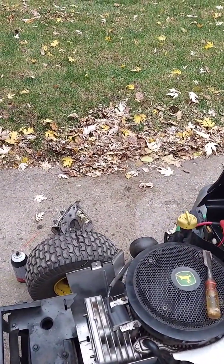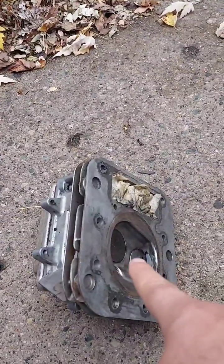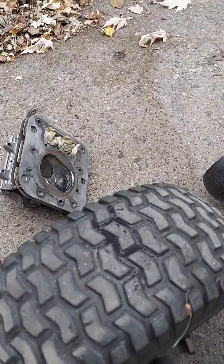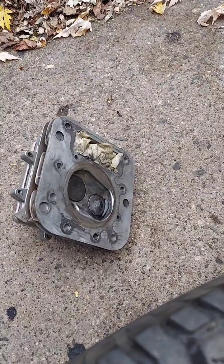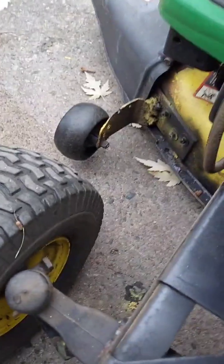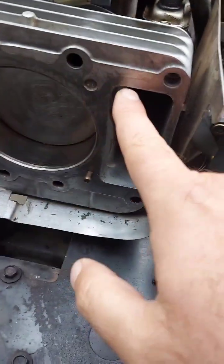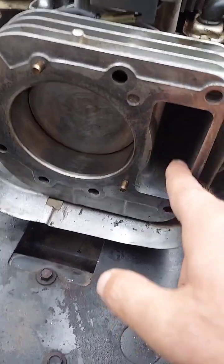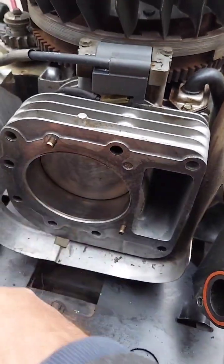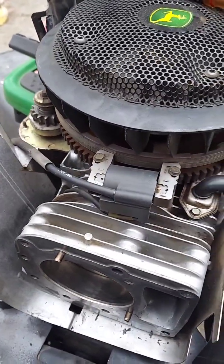So there's the head right here. You've got these two valves — one there, one here. Your piston goes up, and on the explosion stroke you have an intake valve that allows fuel to come through, and then the smaller one is your exhaust valve, so gases from the explosion go out through the exhaust and out the muffler — basically the same as a car engine. There's a head gasket that goes right around here, and it had a little leak causing engine oil to come through and making the engine run rough going uphill and blowing smoke out of the exhaust.